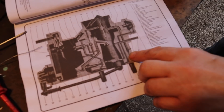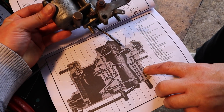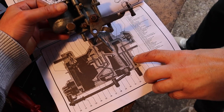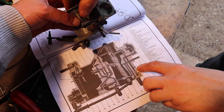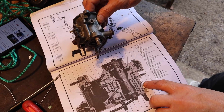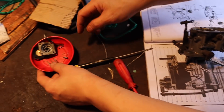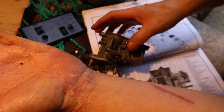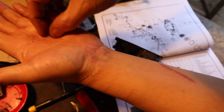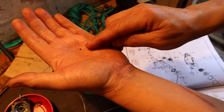What about the carb here? So we had a ball valve — there's a ball valve at the very bottom. There's that little pin there, that's where that goes. That sits like that. Overall we've unblocked the carburetor. There's a little ball bearing — this very tiny little ball bearing — which was stuck at the bottom of the chamber. What this does is when the fuel pumps up, the ball lifts, allowing the fuel through. And when you stop pumping, the ball drops down and acts like a valve.